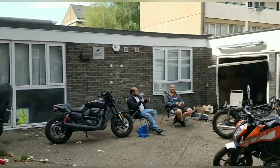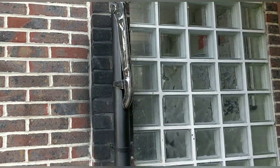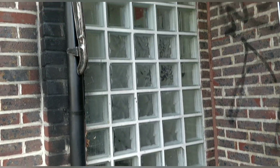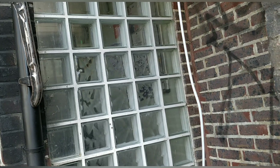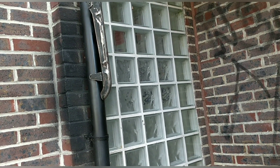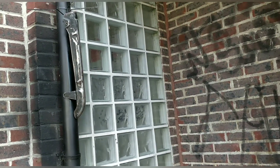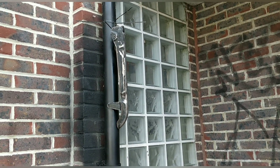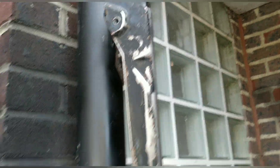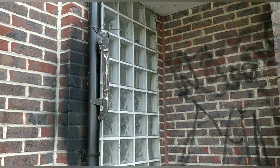So we're all sitting here chatting — there's a bunch of everyone over there — so I thought I might as well do something. I've sanded down the rear chain guard — it took me three hours to sand it down — and I'm just going to use some satin black at this stage. It's just a protective coat to stop the rust coming back through. I haven't done the inside really — what I probably will do eventually is clean the inside and put some Hammerite on. But for now it's just cleaning up. There's the before — you can see where I've sanded it, high spots, low spots, etc. No primer. Straight on with the satin black in light coats and then a couple of heavier ones.